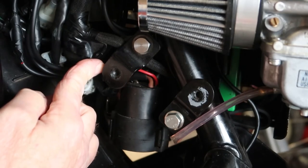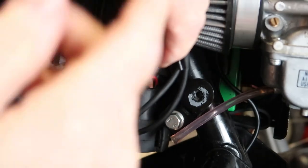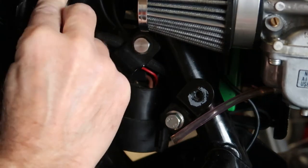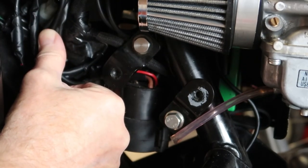If it happens to show the other way — if when you turn the ignition on the needle deflects to the plus or the charge side — it just means that these two wires need swapping round so the current is going through the correct way. But that's it, straightforward really. Any questions, just ask. Very straightforward, so hopefully you can do that quite easily. And I'm just going to put it all back together now — so that's it done.